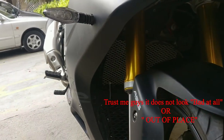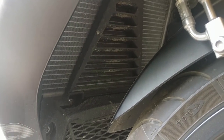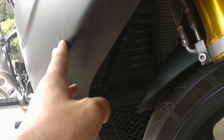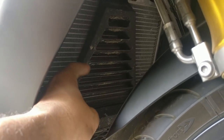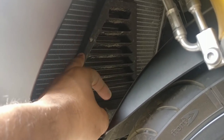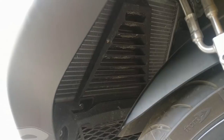One important thing when fitting a radiator guard — whether DIY or the G310R one from AliExpress — you need to open the frame and remove this part. It's fairly easy to remove. Then you put in your radiator guard. In the G310R this part is present, but once you put the radiator guard, this part has to come out. It's perfectly fine though — air still goes in and will cool down your bike.